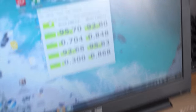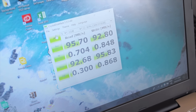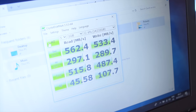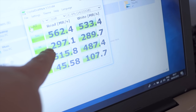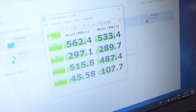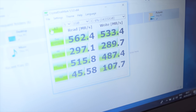So you shouldn't worry too much about spending more money on getting a 500GB SSD or something bigger. I just did the CrystalMark benchmark to see how fast — or how slow, rather — the laptop hard drive is, and the results were fairly impressive. Look at that, that's really really slow. I've never seen it that slow before. The 4K random reads going from 0.7 to 297 is a fairly substantial upgrade.